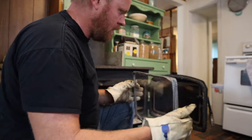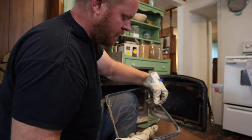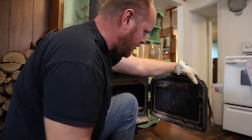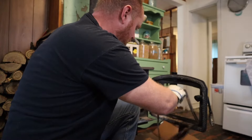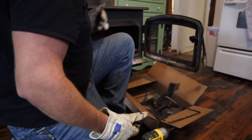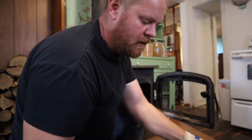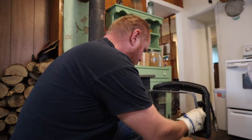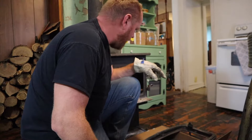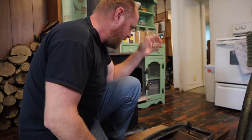What I noticed on this new glass is that the rope gasket is longer on one edge than the other. I'm pretty sure this edge goes in this way, because looking at the glass the rope gasket is pulled down and creates a cushion for the steel to go against. That's why I think it goes that way, and it looks like that's the way this one is set up. There's what I expected to happen — so I need probably this screwdriver to start these screws back. This is a pretty simple thing, and we found the glass on sale — it was kind of pricey but it could have been a lot worse.